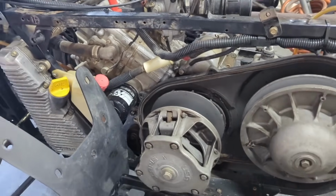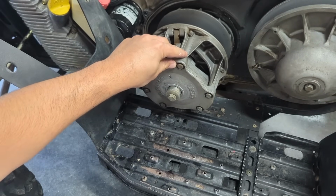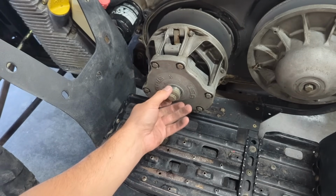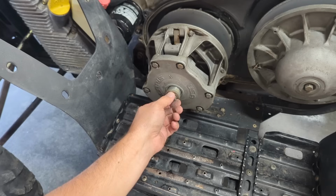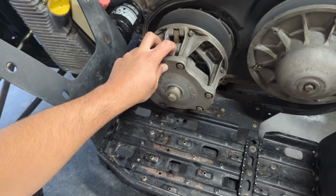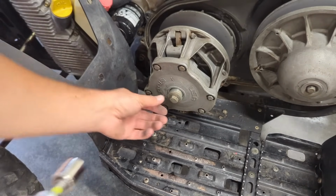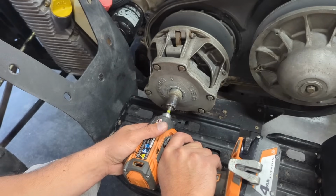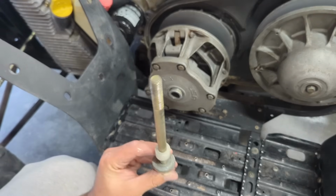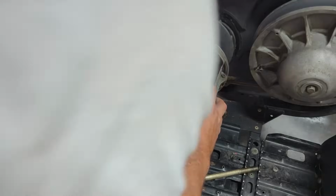Now I'm gonna get this first clutch off. I think this is a primary clutch. The spring is broken, so I think I'm gonna zip these off of here and get them off. Get this off too, actually. I got to get this off in order to get this plate off to redo the spring. But I'm going to put the new spring on here so it's not flopping around anymore. All right, so this is a 5/8. So I'm just going to try to zip this off of here. Came right off. All right, so there's a little bushing there. Need to make sure I don't miss anything.